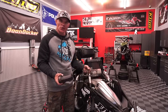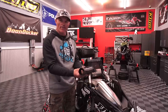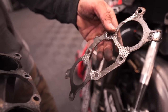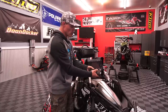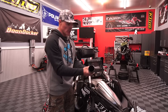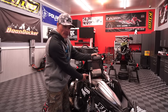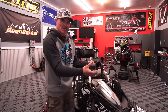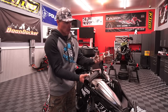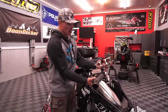Another part of the pre-season checklist is checking for exhaust leaks. A lot of times you'll get an exhaust leak right at the Y-pipe. I've pulled this off another sled — you can tell this gasket is pretty worn out. It bolts to the motor and a lot of times we'll get leakage out of this connection. We've also got a connection where the exhaust wraps around and goes into the silencer or down into the turbo system — even more important to check for exhaust leaks. Replacing that gasket is an awesome part of pre-season.